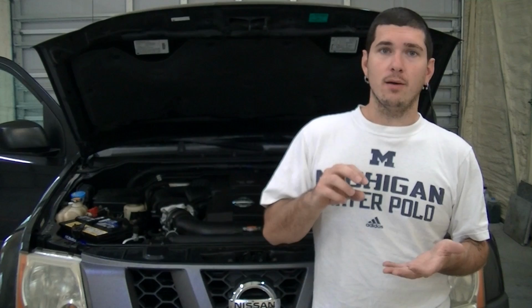One of the pros is one coil can go bad at a time and you don't have total loss of the vehicle. It starts to misfire, of course, but you don't have one single point of failure for the coil pack. Unfortunately, if a coil does go bad, they are very expensive to replace, and there's 6 of them. Either way, that's how it is, we can't change it.